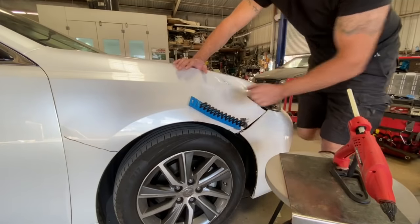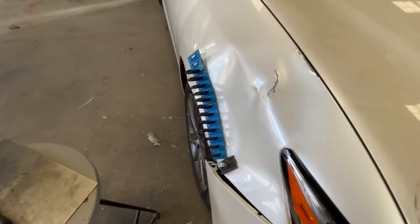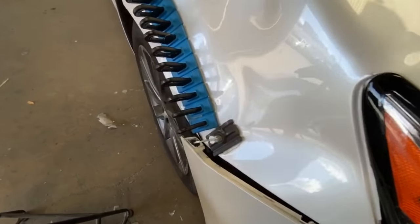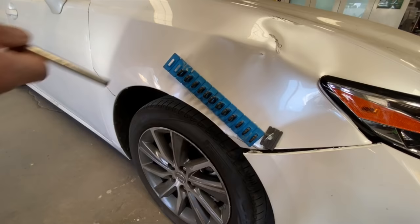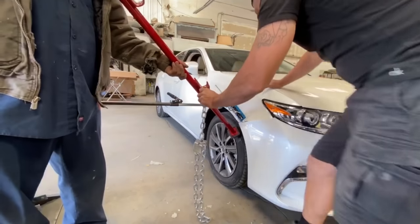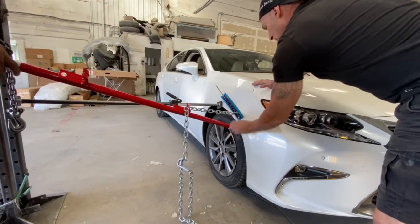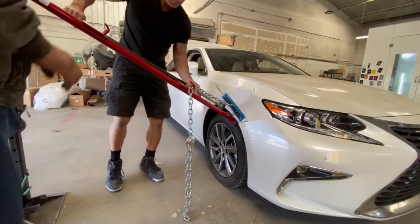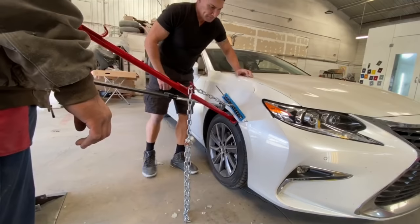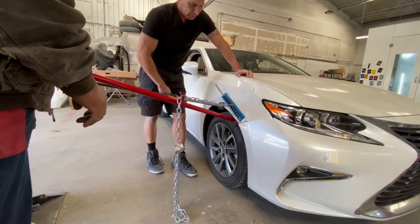I have been here many times so I am just following my mental blueprint on big dents. Let's take a closer look at this large damage smash. I chose these crease tabs because they are wider and can grip and grab more surface on the metal. Time to get my flex on again, beginning the next pull. If you shorten the chain, you can change the degree on the angle of the pull. The goal here is lining up the fender edge with the bumper edge. These big dents come out much cleaner with large glue tabs rather than pushing on the back side with rods and flat bars.